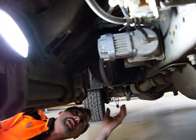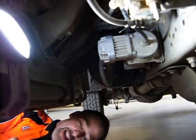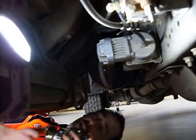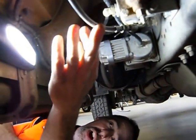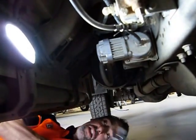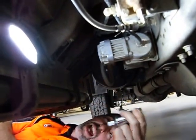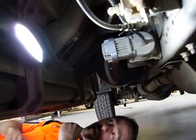Under here on the chassis we've mounted up the tank and the compressor. The hydraulic reaction valve is mounted here. There's two braided lines that come down from the master cylinder — I'll show you the hook-in there later — and that controls the hydraulic piston in the reaction valve, which allows the air to flow. There's also a solenoid, similar to this 12 volt solenoid, that dumps the air when the ignition's turned off or the handbrake's applied.